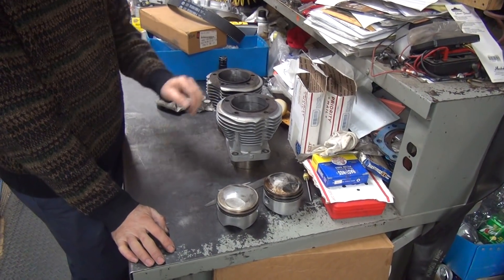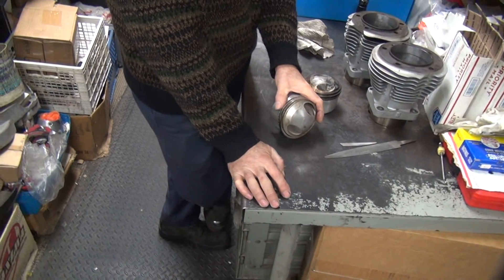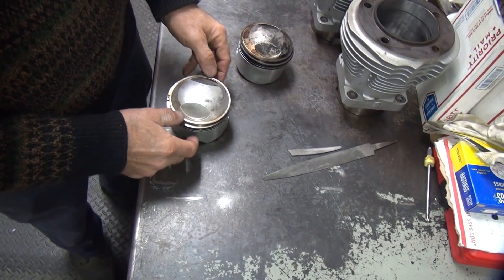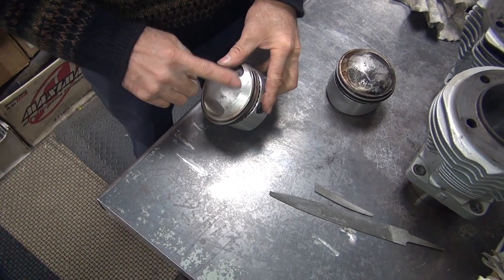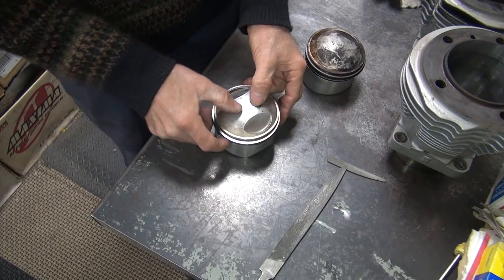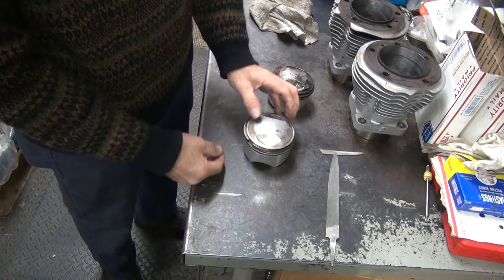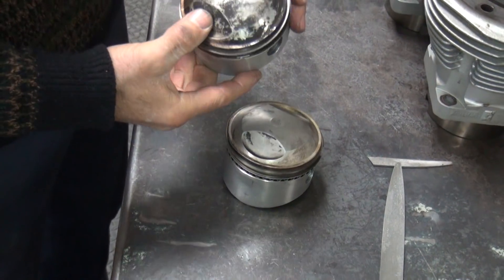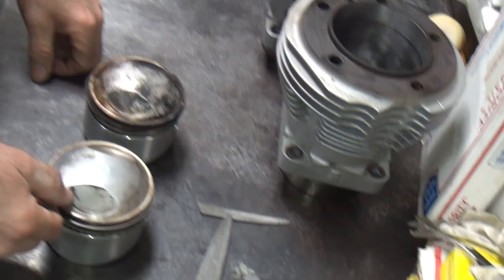So what else do you need to fix on your bike? I think that should be it. I got some heads that we can look at. Now you want to lower the compression a little bit? I'm going to deburr out all this area through here - it'll make it breathe better, it'll lower the compression a little bit. 10.7 - I don't need it, knock that down a little bit. Go in here and take off that edge right there, radius that all in nice and clean. You put it in another machine you can knock this down to about a silver dollar size - knock off the dome slightly. It'll knock off quite a bit off that center point - that'll bring it down a little bit of compression so it won't keep pinging and killing your motor. Just triple stack the gaskets. You can just do that by hand on a file if you want to - get your dremel out.